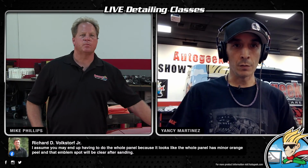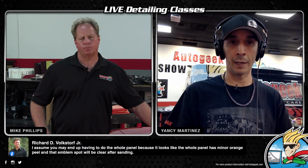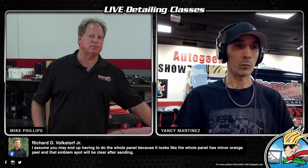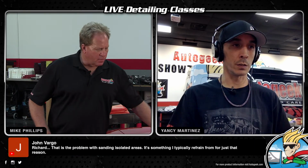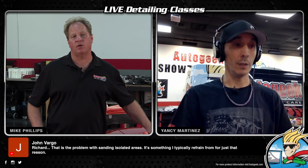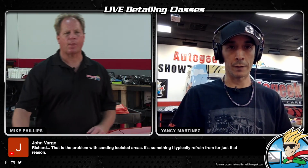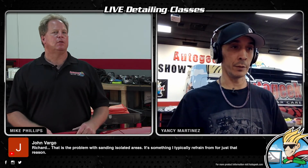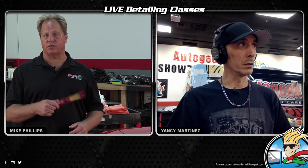All right, we have Richard. I assume you may end up having the whole panel, because it looks like the whole panel has minor orange peel, and the emblem spot will be clear after sanding. Yeah, but once you put the emblem on, it's a non-issue. Me looking at it, there's not enough difference to make a hill of beans. Don't major on the minors. John was answering Richard: that's the problem with sanding isolated areas, and there's typically a refrain from doing it for that reason. It just all depends on the paint. Everybody can make their own decision about what they want to do on the car they're working on. I chose to fix this and make it look better.